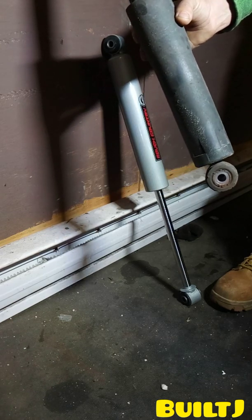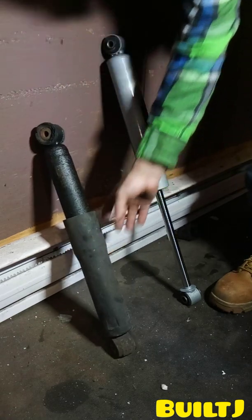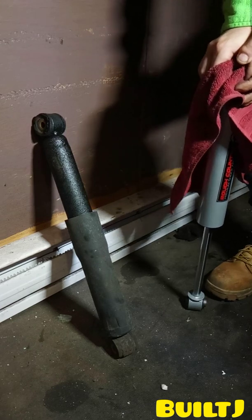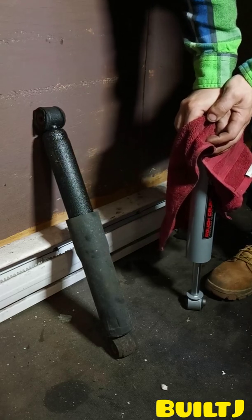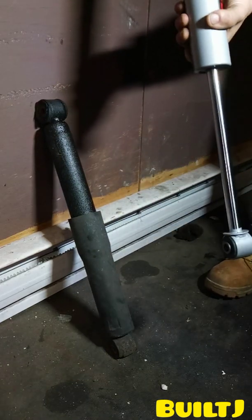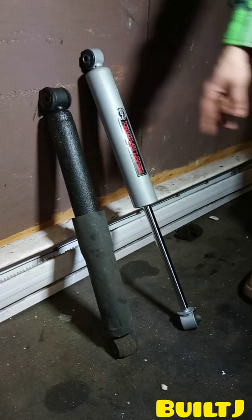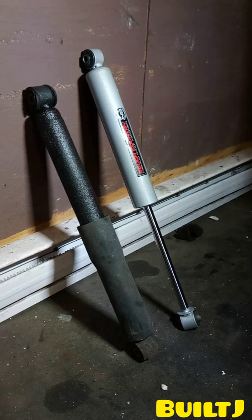It still works, but it's on its way out. Once all that liquid comes out of the strut, it is no good. But you can see it slowly making its way back out. So now the new strut, I'll go ahead and apply down pressure. It's a little bit harder. But once I let go, that shock comes right back out quick to spec, or stock spec on this. But that's how you quickly and efficiently check if your shock is blown. You can see that one's still coming back when this one did it very quickly. But that's one way to check your shocks.